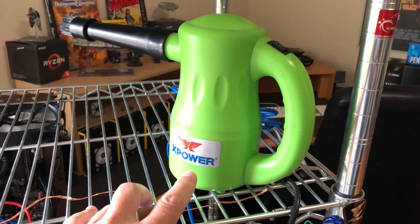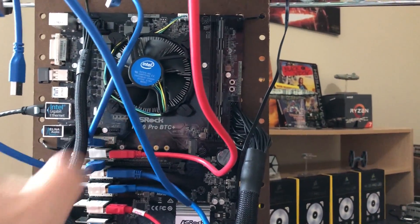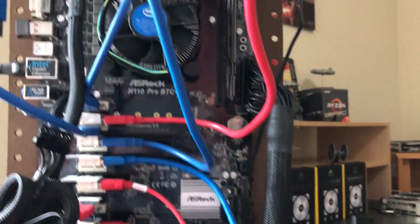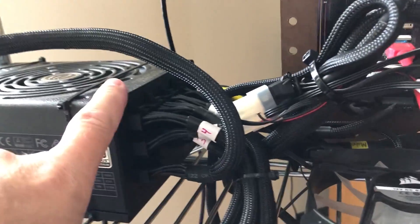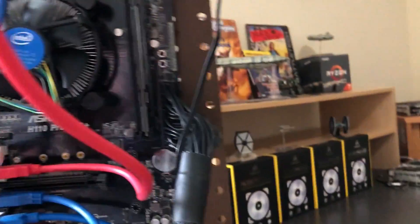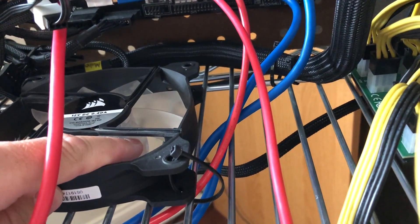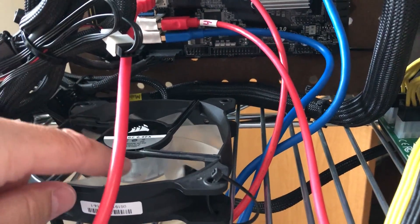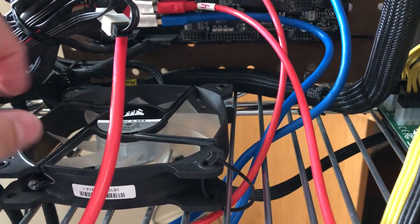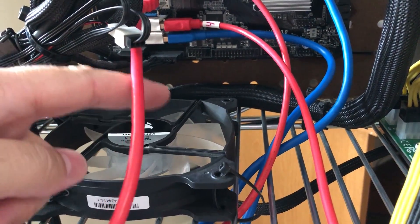I was using my air compressor to do some dusting on the parts I'm repurposing. Since I already had the motherboard and CPU connected — the CPU was already mounted — we had some dust collecting in there. We also replaced a 750 watt power supply with the 1200 watt. A tip: anytime you're dusting inside these fans, you always want to stop the fan from spinning. If you blast it and it hits too high an RPM, you can actually burn out the motor while it's off — you'll turn it back on and the fan won't work. Just use a pencil or something to hold it in place while dusting inside the fan.